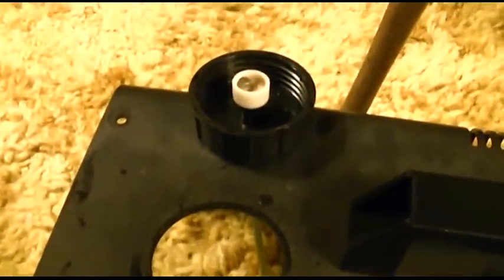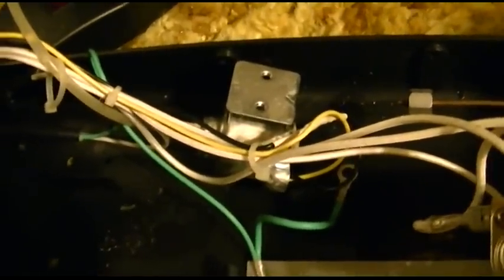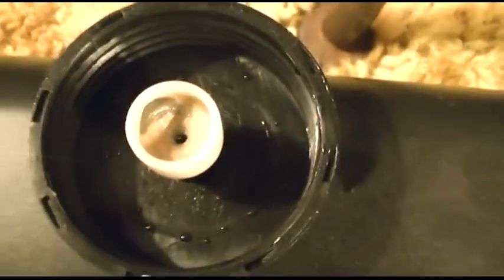I don't know why it doesn't work because it certainly hums and it seems like it should. About the only last thing I have to do is put some compressed air through there and see if I feel it through the pump — make sure there's no blockage, because there is certainly the possibility that the pump could have gotten blocked by some crap. That thing does not look as clean as I would like, so I'm going to see what happens with some compressed air.